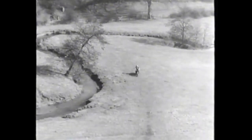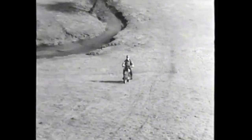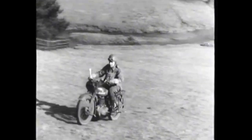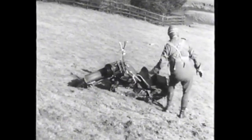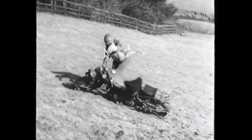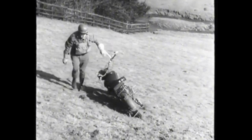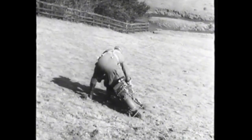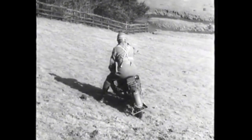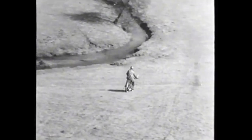That wasn't very difficult, was it? Let's see it once more and watch the points very carefully. Fast approach. Throttle closed. Lay it on the footrest. Pull it round by the mudguard stay, steadying the machine with the handlebar. Be sure it's in bottom gear. Front brake on, foot on footrest, front brake off, valve lifter up, and down the hill. As in the previous climb, the clutch was not touched, and must never be.